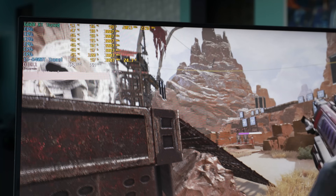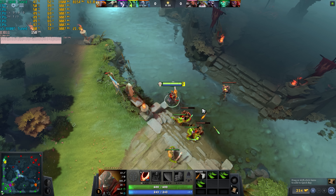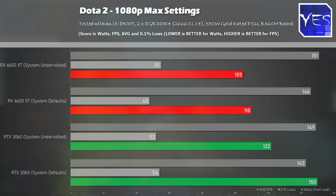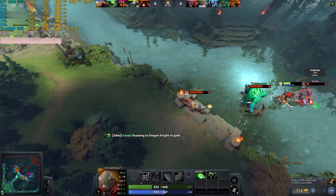The next two titles are CSGO and Dota 2. Even at max settings at 1080p, these titles weren't stressing the graphics card at 100%. In Dota 2, we saw out of the box 150 watts drop down to 122 watts after undervolting and tuning, and the FPS actually went up on the Nvidia side — just like the AMD side — meaning we needed a bit more CPU performance to push FPS higher. The 6600 XT did edge it out in lower power consumption in Dota 2, just like with the other three titles.